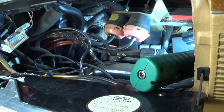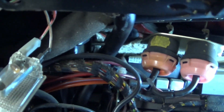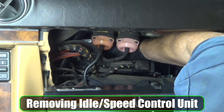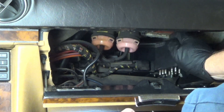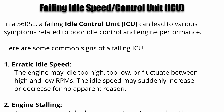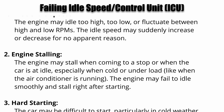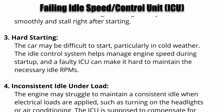Taking that liner out was the easy part. You can see right back there — behind this one with the label, there's another one which you can't even see. That would be your fuel pump relay. So you have to hold the harness part from underneath here while you pull up and wiggle back and forth until it comes out. That's the idle speed controller — that's the one with the label on it.